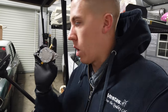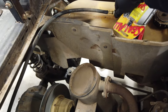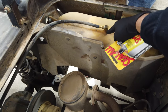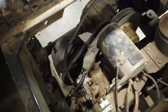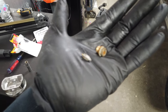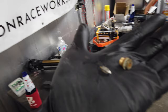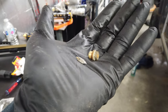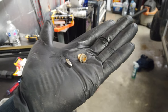Fast forward a few days — got a new fuel pump in, going to get it installed on the golf cart and see if this helps it run. I also got some seal-all because this thing's loose and comes out of there — going to add some seal-all to help seal this up, then reconnect everything so we know we're not losing suction. New pump should just be two bolts — clean it up a little bit, stick the new one on. The new fuel pump doesn't seem to want to suck the fuel out of the fuel tank though. We went in past where it enters the carb — this is the little float that controls whether or not it gets extra fuel into the carb — and it still had a bunch of junk on it. We kind of cleaned it last time, apparently not good enough. Pulled it apart and we're going to put it back together and hopefully this will allow fuel into the bowl and then it'll start.